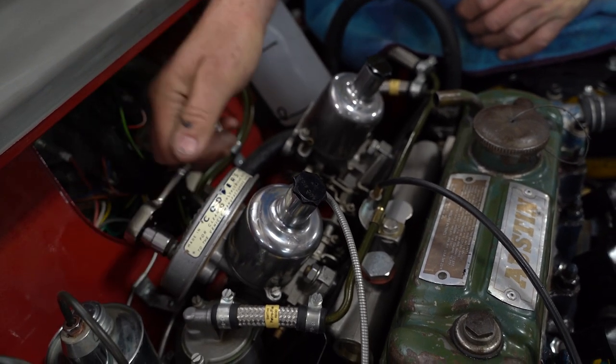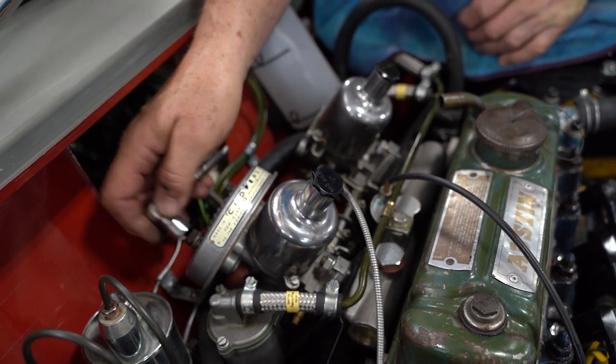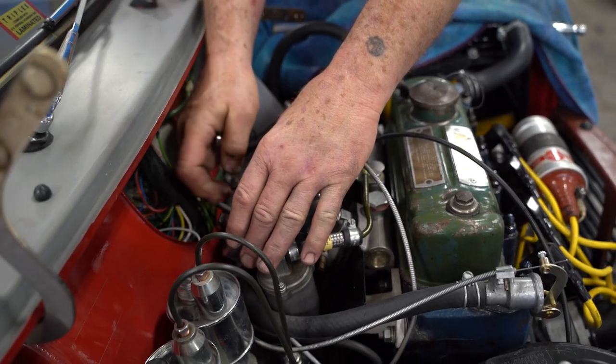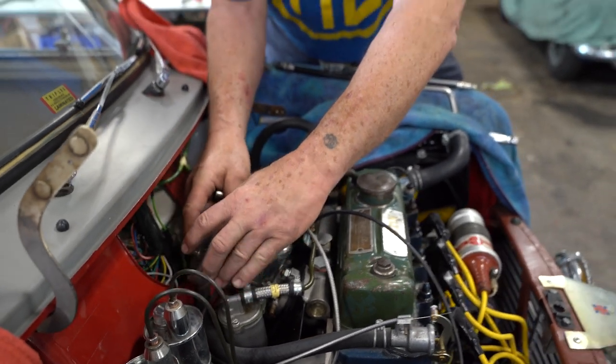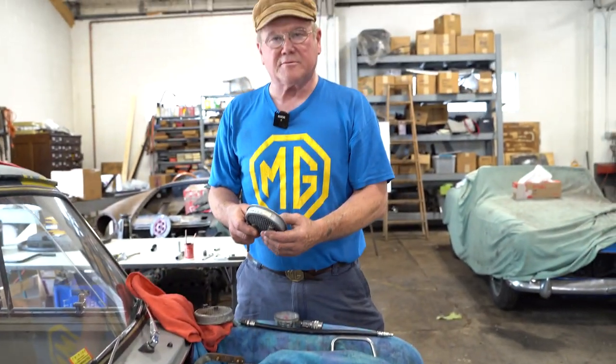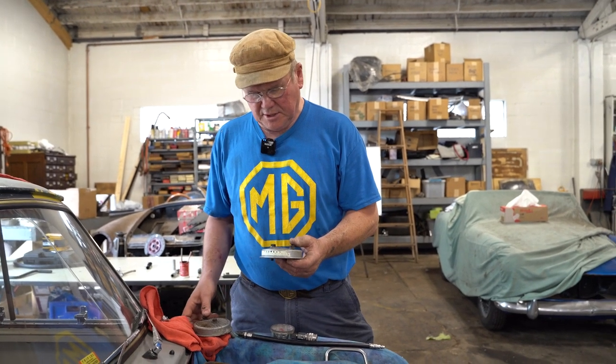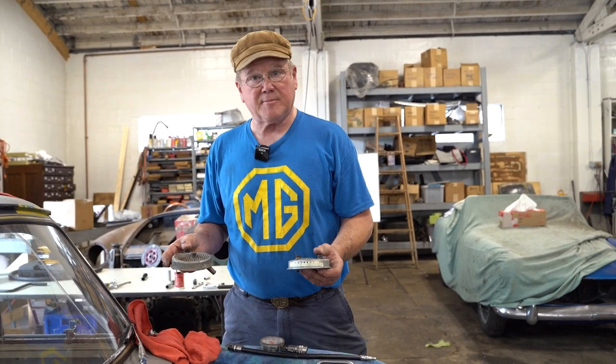And again, if you want to see somebody who got mirrors on their dash pots, it's on my Facebook page, University Motors LTD. Some guy wrote in and said how he stepped up through, started with 80 grit or some kind of real coarse paper. And somebody else came in underneath that and said, well, wouldn't sandpaper scratch it up? It's like, yes, but that's why it's polishing. You start with something really coarse and work up until you're finally at the aluminum rouge, white rouge, something on the buffing wheel. So I'm going to blow these out, and I'll be back in a minute.